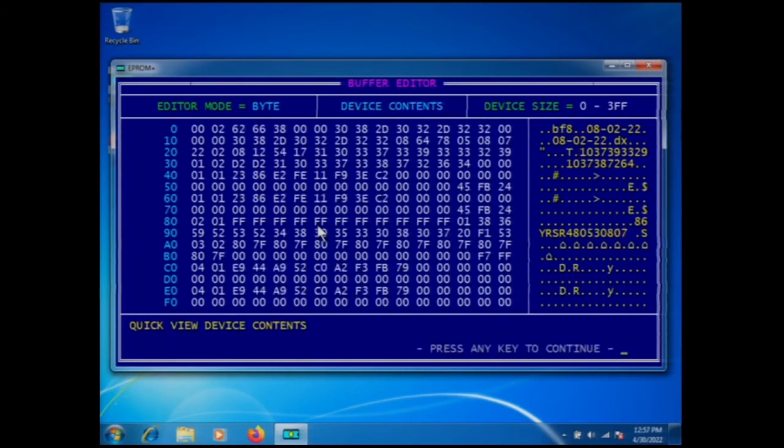So I'm going to press Q, and you'll see that this is different data. This is the data from the salvage vehicle module. Now I haven't put it into the buffer. I don't want to put it into the buffer because I've got the data from our source module in the buffer. But with Quick View, if you don't have the clip attached to the part properly, or if the part has some humidity sealant on it or something that's preventing it from getting a good read, you can use the Quick View command and determine whether or not you're connected, and if you're not connected, then you can take whatever actions you need to remedy the connection, make sure that it's proper. All right, so we're hooked up.